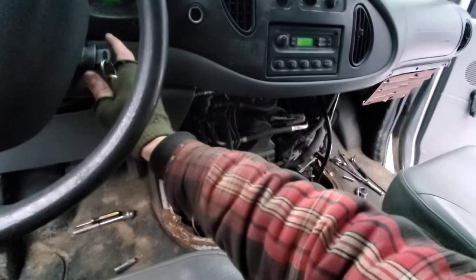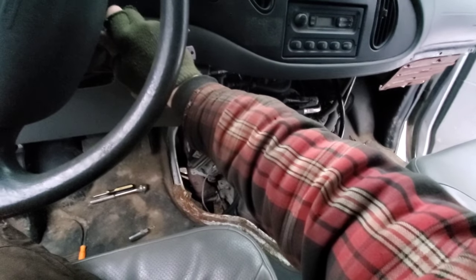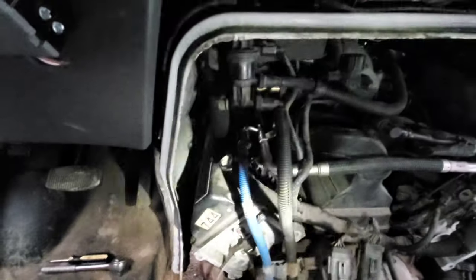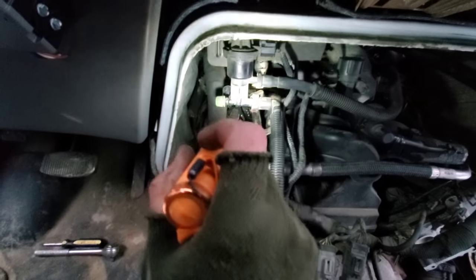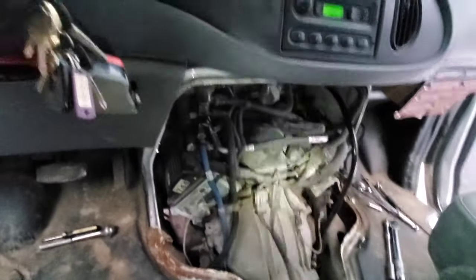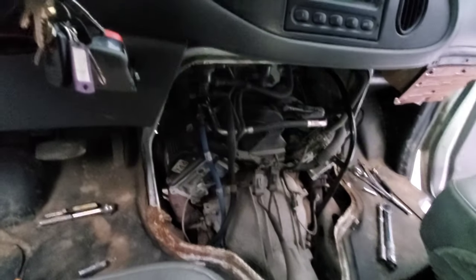We cycled the fuel pump three times — let's see if it comes to life. We're going to check and make sure there's no fuel rail leak just in case we need to redo O-rings. We look to be doing pretty good. So there you go — that's your coil install and spark plugs with a couple of nice little hints. Good luck with yours.